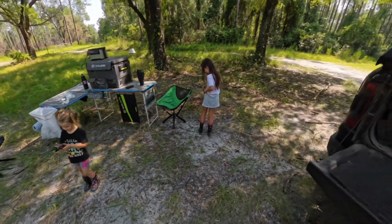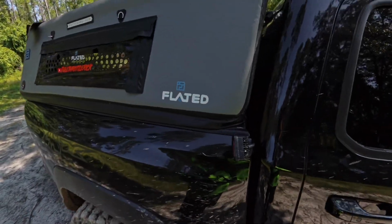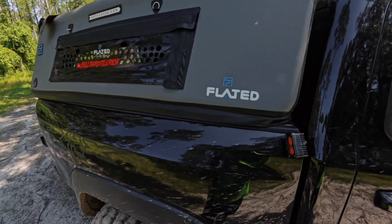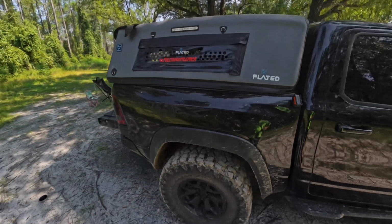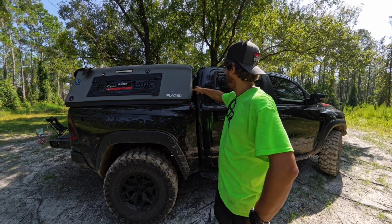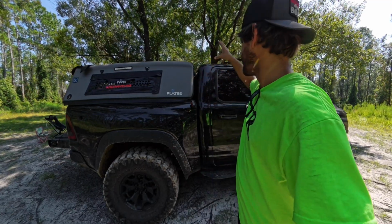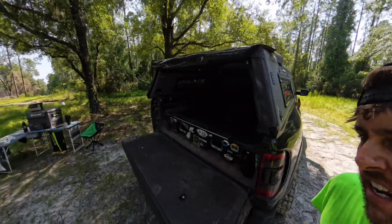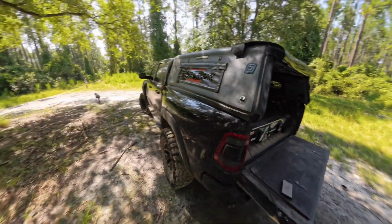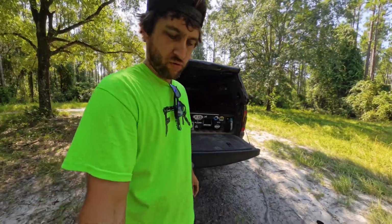Okay? Good? Good. All right, so like I was saying, if you are doing some extreme wheeling, there is a chance, though we've never had this happen. Actually, now that we've secured it properly, we just tied the straps a little tighter and give a little bit more space from the cab. We've never had this issue again. On the 2-week trip to Colorado, we did all sorts of off-camber stuff and never had the issue, but we did have it happen once at Windrock where it shifted forward and made a squeaky boot sound. So just something to consider. Tie your straps down a little tighter, cinch them down, and you'll be good to go. Probably one of the few people that will have this issue, and it's not really an issue, just something to keep in mind, right?